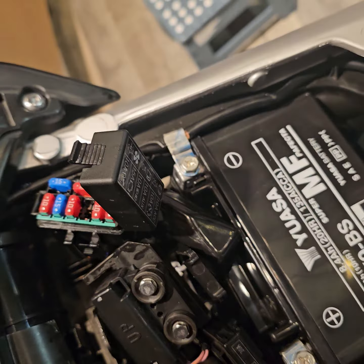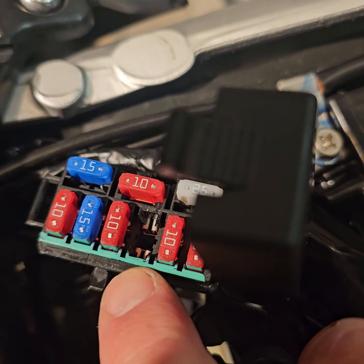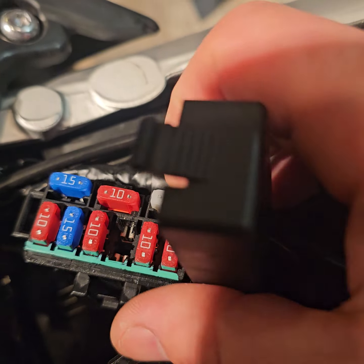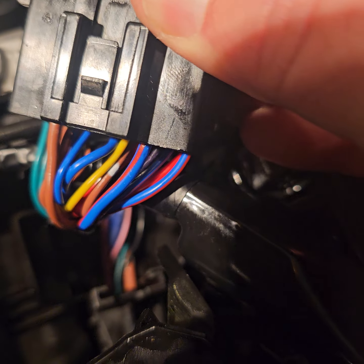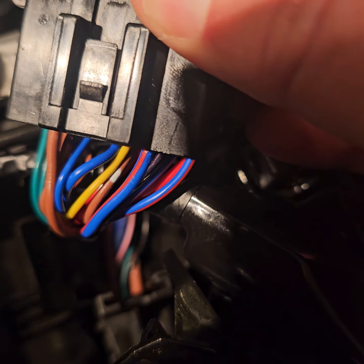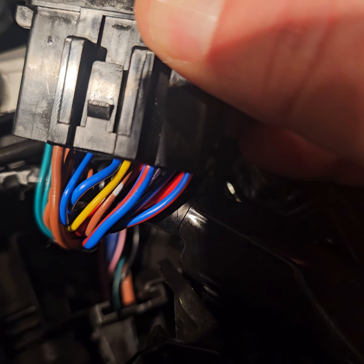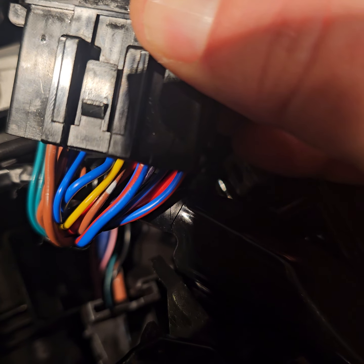Right, and the positive side of the fuse board, like I say, is this side. So that's your positive right there for your auxiliary. But okay, so you see the yellow and the brown and white dot? They're both your auxiliary. But the yellow is the positive in, and the brown and white is the positive out. That's the one we're interested in, okay?